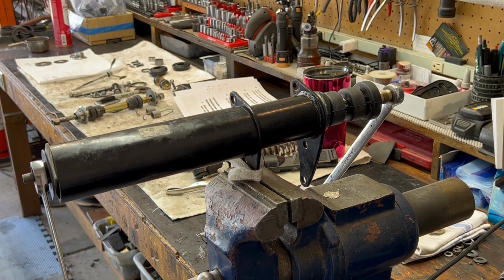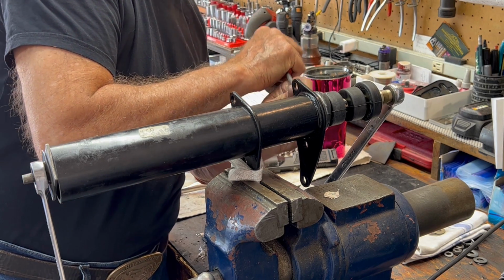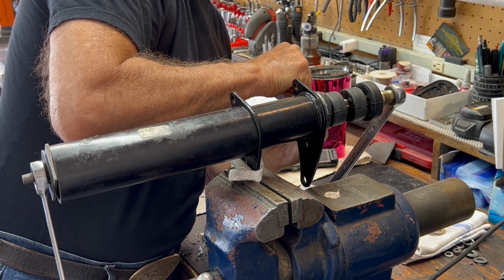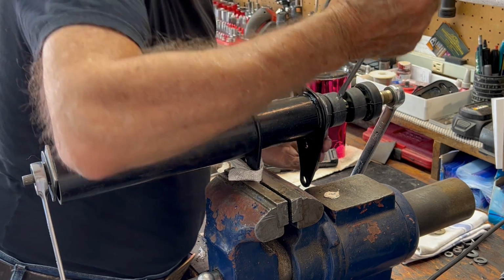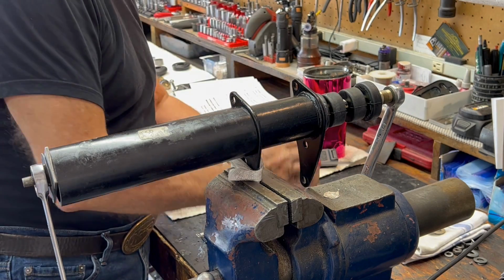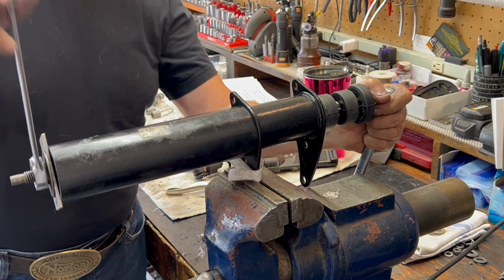All right, preparing to pull the front rubber ISOs into the front motor mount. Little bit of pressure on them. Help it feed its way in. Hopefully without stabbing myself. I lubricated it with a little bit of white lithium grease, unless you think I shouldn't have used white lithium grease, in which case I didn't. But there, we got a good start, nice even all the way around. Let's see how it goes. And pulling nicely.